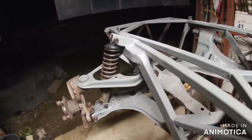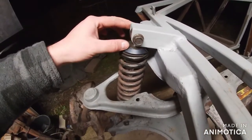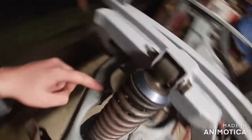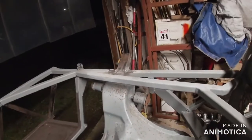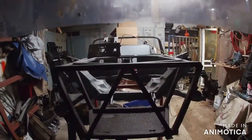Right, so fast forward a few weeks from the last clip. This is what I decided to do. I've started to weld right around here underneath — nice strong mount there for the spring now. So that's how it'll sit. I need to put a strengthening piece in from here to here, but I'll do that when these are off the car before I paint everything. As you can see over there, I've done the same thing on that side. And I finally did a little bit of welding in there for the steering — put on the steering rack if you remember from a few episodes ago. They're quite well matched, both the same both sides.